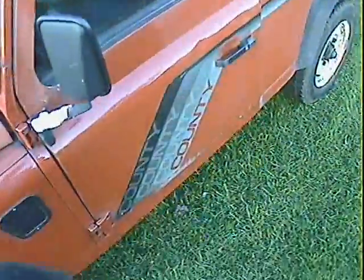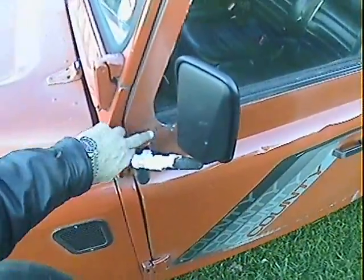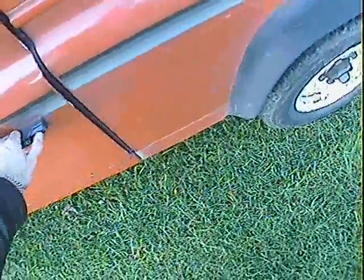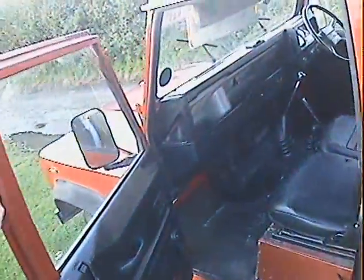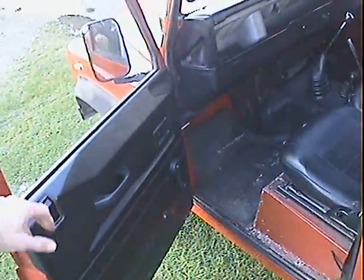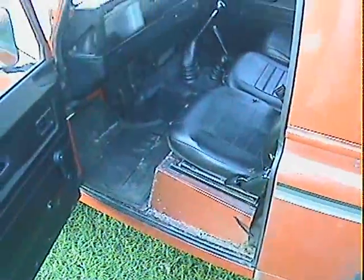The screen on the passenger side is fine, as it is on the driver's side. The roof's nice. There's some electrolytic reaction on the nearside mirror housing and some bubbling on the door top and along the bottom edge of the passenger door. The nearside door latch needs adjustment — it holds but it's not shutting as it should, just needs a little adjustment. The passenger window regulator isn't too clever either — a couple of times when you've wound the window down it's slipped, so it probably needs a new regulator.